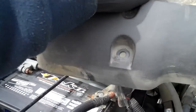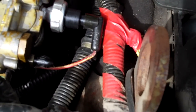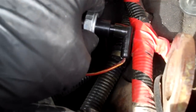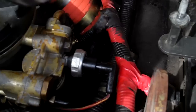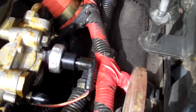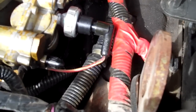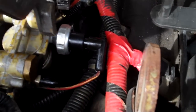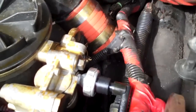Three bolts, and they're 13 millimeter half inch. But to get to that, you can't use your normal socket — it looks like an oil sending unit, but you can't use an oil sending unit socket unless you really take a lot apart. You have to take off the mount to pull the engine, and you have to take off the mount for the turbo. So what I do is use a pair of channel lock pliers — and before everybody cringes thinking about me crushing the plastic inside and creating a leak on the new one — you can do it, you just have to do it gently. Use the ribs on this, and I'm not squeezing hard at all. I'm only using those ribs and the bite of the pliers just to tighten that in.